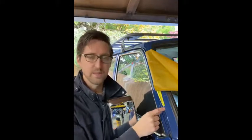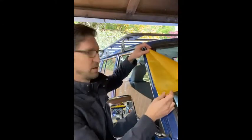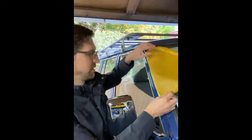What that means is it's less time to go back and sand and make it look like a nice blended job. You can of course do the hard edge, but then you get a built up hard edge and it's a lot more work to blend it. So it's worth it to do the soft edge taping here and mask it off nicely.